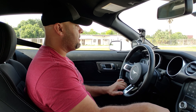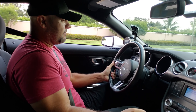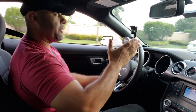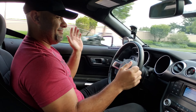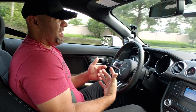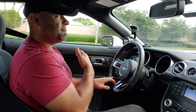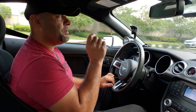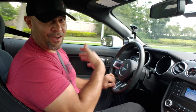In third gear at 6,000 RPM and up that speedo goes whoop — it really starts to pull. One, two — didn't blaze the tires but as you heard it was enough to break them loose and be on the verge of traction. Maybe one pulley size smaller would be just right with a sticky set of tires, but these are the bone stock Michelin tires. Let's take a look at the log and see what we've got.